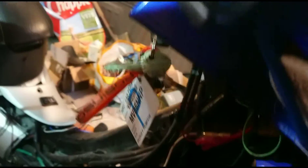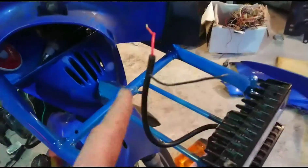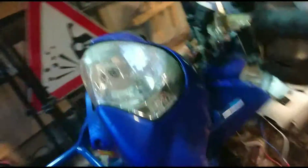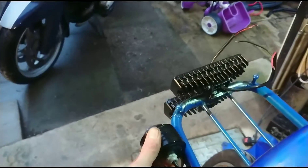So when the ignition switch is live, the relay goes active and the power from that positive cable will come up here, through here, and feed a spotlight — which is actually a fog light, quite directional, so I'm going to point this at the ground. I haven't mounted this yet — that will go here somewhere, pointing down.